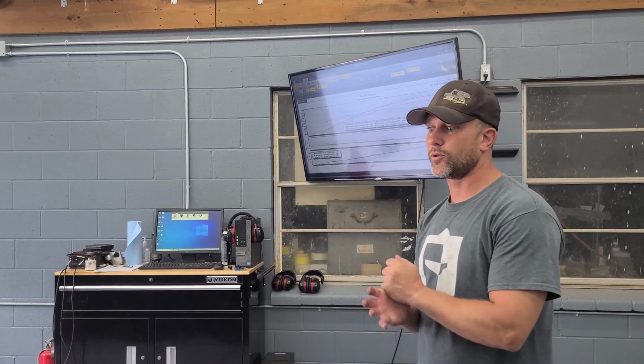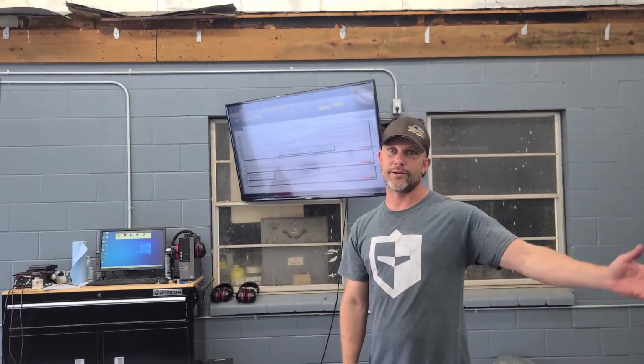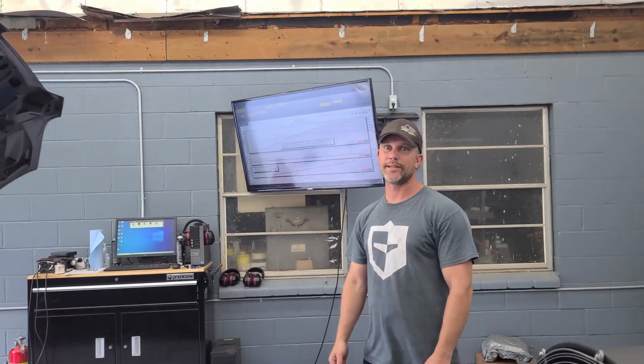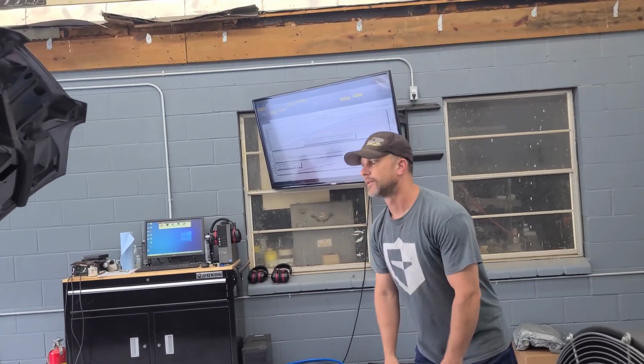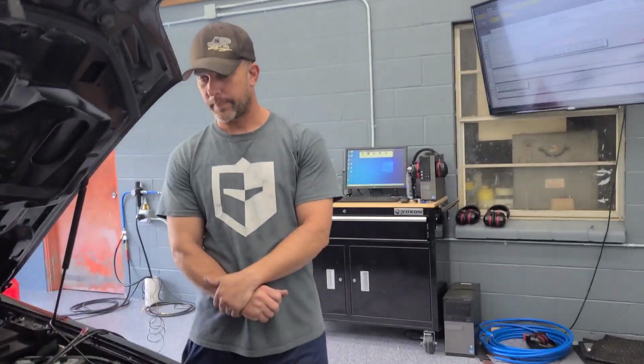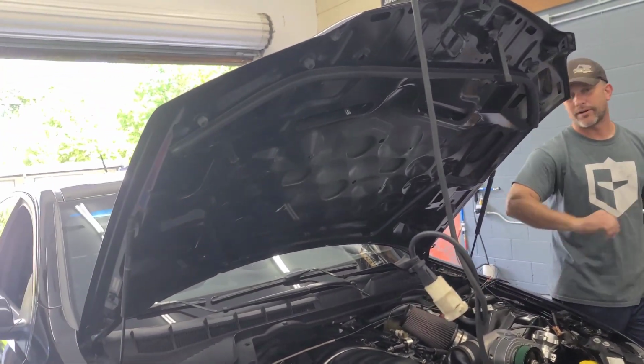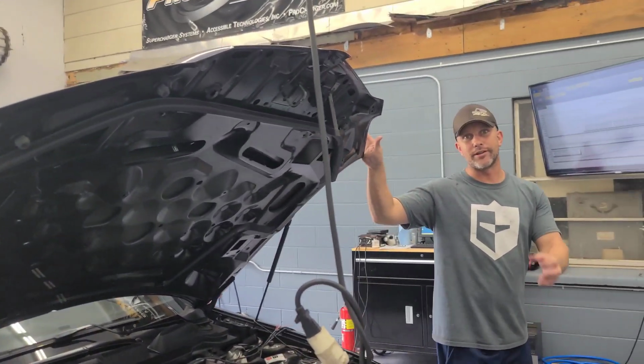If you redline this blower, that's all it's going to do. Whatever it's on, it might make 30 pounds of boost on a four cylinder. It might make 15 on a V8 and the same. So I think we're getting close to this max. We're probably close to the three-core max. We maxed the injector. Probably the fuel rails. So we're looking at the fuel rail too.